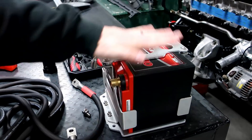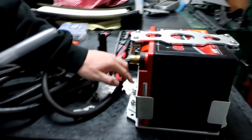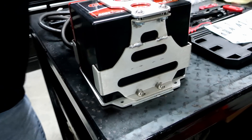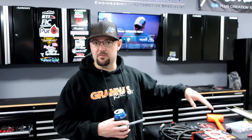I didn't want this to be seen. On the side of it, it has drilled holes here, there, and there, and then it has two on this side. I'm going to drill a hole here and on this side, then use a rivet nut gun to make actual rivets in the actual body so we can screw in and out and not use self-tapping screws, because I absolutely despise those.